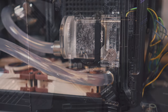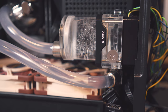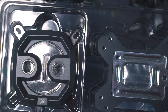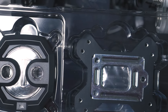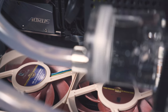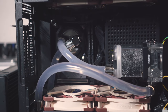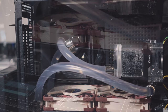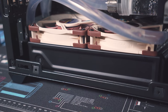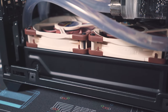For the pump, EK's Kinetic 120 DDC running at 40%. The CPU block is the Corsair Hydro X XC7. Fans are the Noctua NF-A12x25, locked at both 1200 and 1500 RPM on the rad for two different tests, and also mounted as top exhaust locked at 1200 RPM. These fans are exceedingly quiet, and I think the 1500 RPM level represents the higher end of what performance users who still want a silent system will choose.